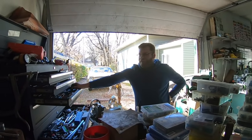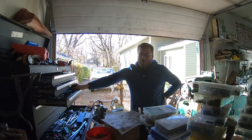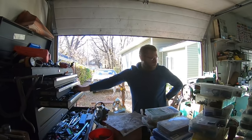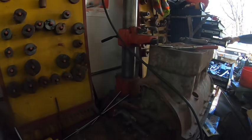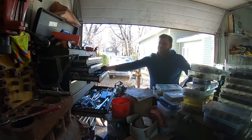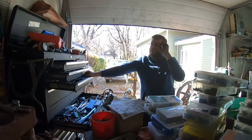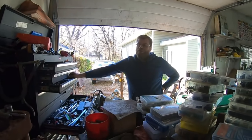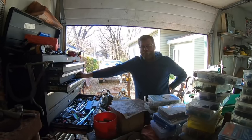This machine really isn't designed for it, but we phoned around Winnipeg and nobody wanted to do it anymore — nobody had the capabilities they said. So whatever — I thought it was super fussy to put seats in so I made ground plates for this thing. On the IDL, there's a key slot and everything centers the machine. I thought everything was super fussy so we made these parts that keyed everything and centered around the cam bearings — then we go to do it and it didn't even matter because we just had some quick thing up. It does go high enough to do a V8 flathead — that's about the limit of the machine. Then we found out there was a guy that actually does machine work like this in his garage for 10 bucks a piece. So we went to all that work and it wasn't worth it — but whatever.